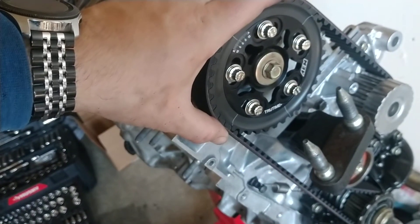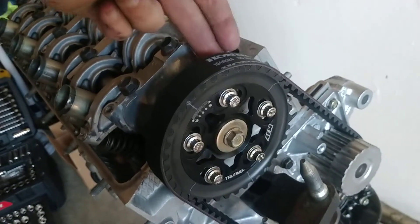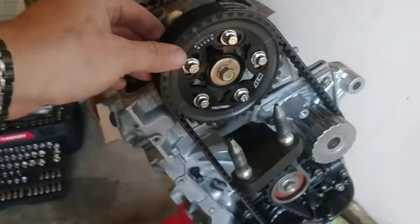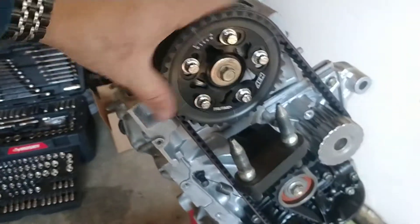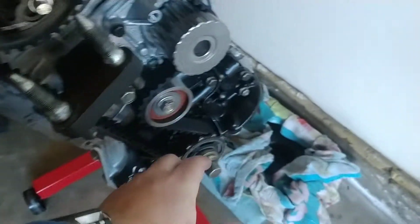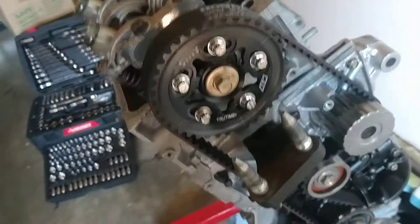You're going to put it onto the cam assembly itself. Make sure you've got a brand new cam seal behind it, as well as a brand new crank seal. I suggest Honda OEM — they're really good and they last a long time. So once you get the cam on here, it does come with its own shear key, unlike the OEM which has a built-in shear key. You're going to get a shear key just like your crank pulley has. Slide that in and lock that in place.